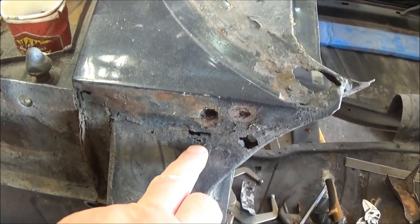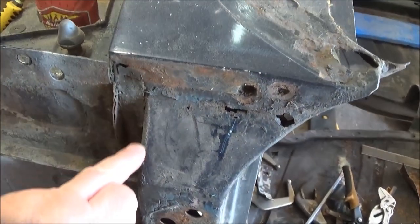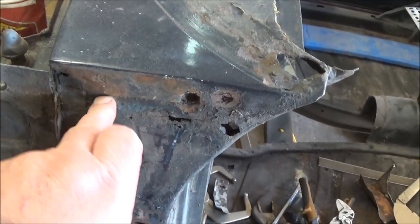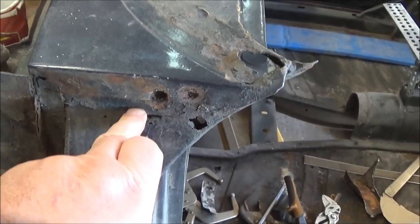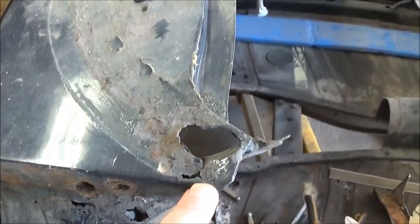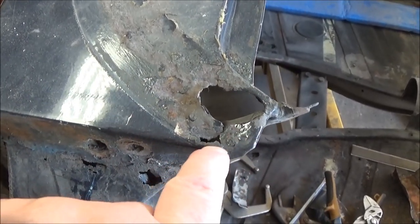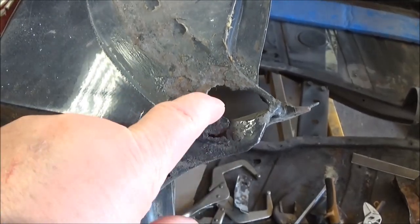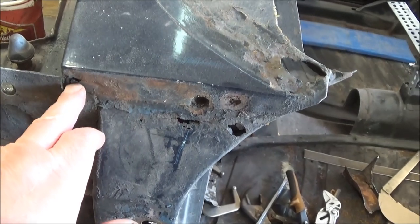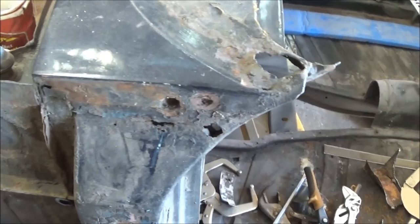You can see I've got some perforations here in the metal. The middle is pretty thin — looks like it's had a repair here previously. We're going to do a little wire brushing and see what the extent of this damage is, hopefully it's not too bad. I also need to do some repairs up the top here where the post for the windscreen goes through — you can see it's got some tin worm here as well, so a little bit of repair is required there.